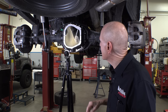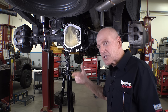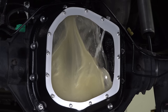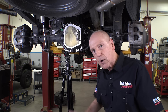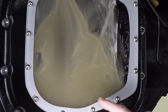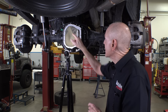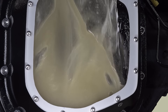Let's go to 20. It's driving the lube right into the flat surface. I can see in there we still don't have any lube going over with the ring gear and we're at 20 miles an hour. You can see down in the bottom here it's driving the fluid right into the surface, and then it's going up to the top where it hits and waterfalls off.